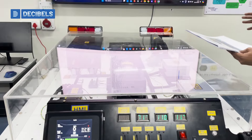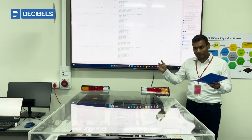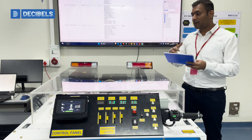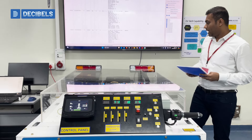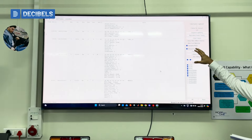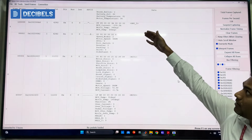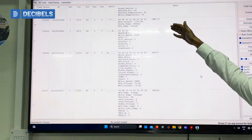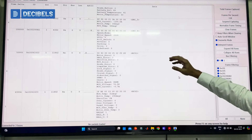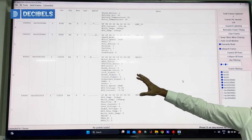On a simplistic level, the overall idea of this equipment is to give an understanding of the components, subsystems, their integration, and the functionality as a complete system. We have also developed a complete CAN-DBC for the overall setup. This means you get all the data from the different systems — data coming from the BMS, the motor, and the motor controller — all coming directly from the CAN with the help of our VECU.